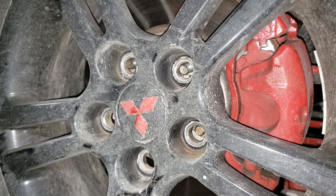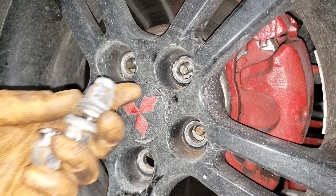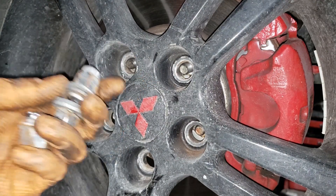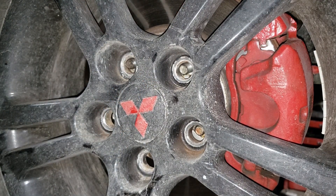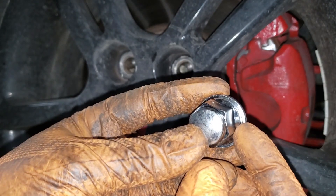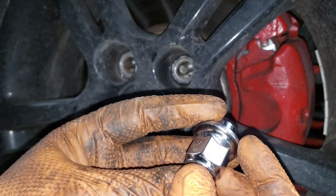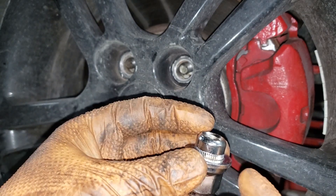This is a pathetic solution — if you have a mechanic who recommends such a thing, don't take your car back there because it's just not worth your life. Some people may feel that's dramatic, but it's not — I've worked in this industry for quite a while and I've seen this exact same thing. I don't even know why this sort of stuff is listed as a replacement for this style of wheel. This here is a proper replacement — you can see the lug has a large area that will distribute the clamping force applied when you torque this bolt through to the washer.